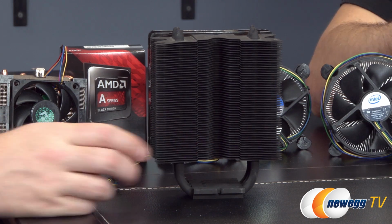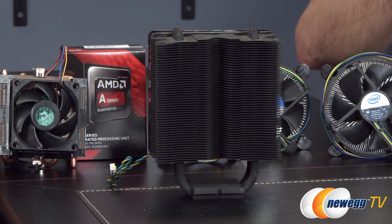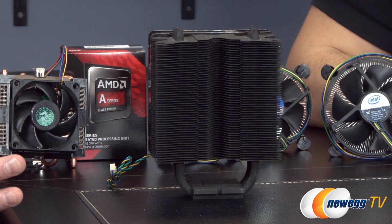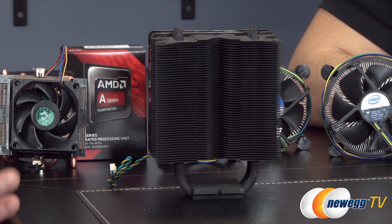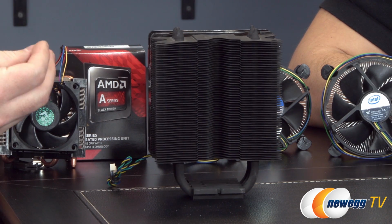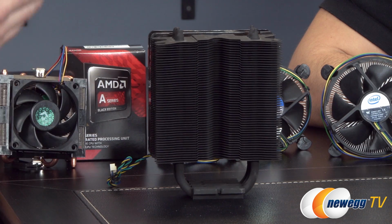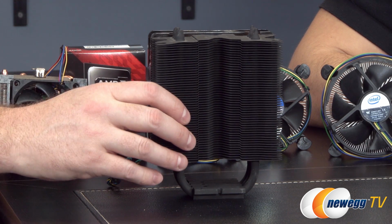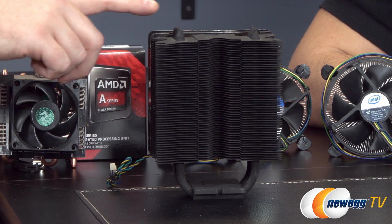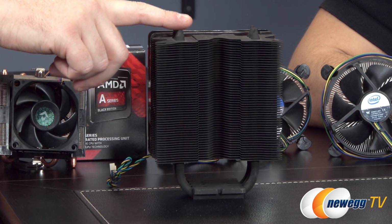By that you mean that it changes state from liquid to steam or gas, and then it goes to the top. And yes, condenses, depending on the heat pipe. There are some that work slightly different ways, but that's the general idea. And because liquid water in particular is very good at absorbing heat and transferring it, that's sort of the way that those heat pipes work. So the reason I bring this up is you cannot cut these.